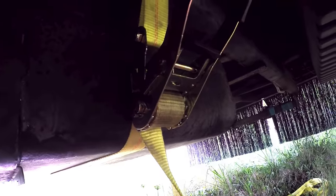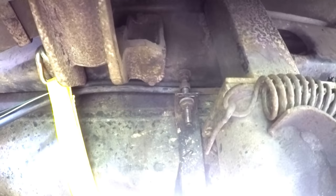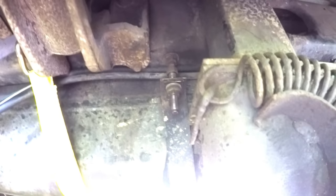Also, your other option is to cut the strap so that you don't have two straps winding up on the spool. And if you're familiar with these tie-down ratchets, you'll know what I'm talking about. So I've got the bolt on the front of the tank. That's all nice and tight. And I was able to get this one here tightened up. And I have the one in the rear, which is the same thing, over here, to tighten up. All right, and as soon as I get those tight, I can release the straps, and then those metal straps that go across the bottom of the tank will do the remainder of the work. So let me do that, and let me shut the camera off so we don't run out of battery again, and then I'll come back when it's time to remove the straps and the job will be complete. All right, yes, I'm here. I wasn't far away.